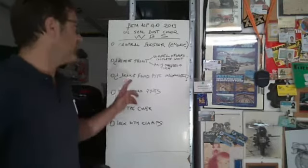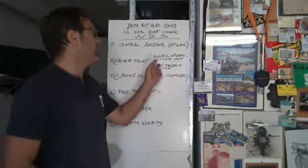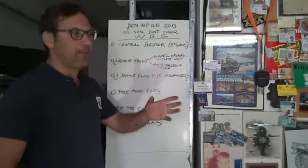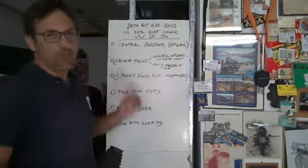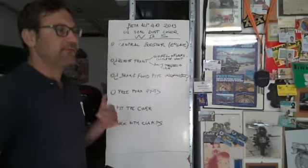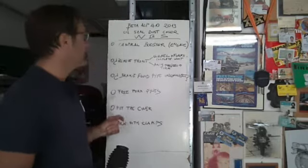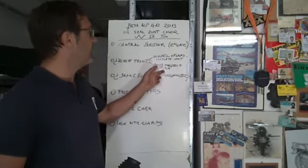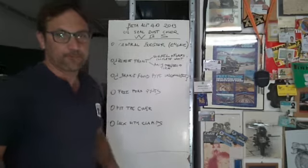So the question is, if we want to mount the wheel and forks as a complete unit, we have to mount all the front end in one piece. Otherwise, if you want to disassemble the part of the fork, which are the stanchions, we have to remove the wheel axis, the wheel, and then the fork.